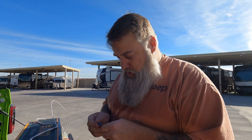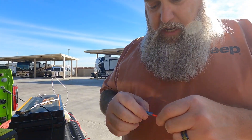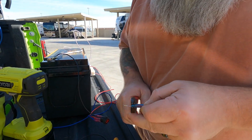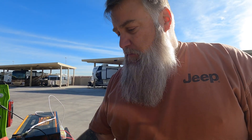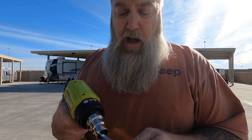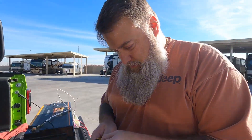You also want to make sure your fuse is not too large for what you're working on. There's a 10-amp fuse in here because these only draw a total of 10 amps combined — and it's actually the fuse they gave me when I bought the heaters. The heaters did come as a pack, two of them together, because they're made for a larger tank. You can get them separately, but I got two because I wanted to totally wrap the battery. You want to surround the battery with heat since it's staying outside.